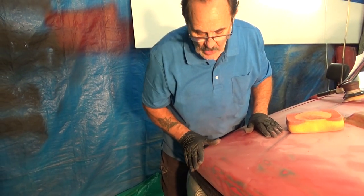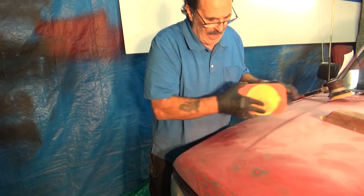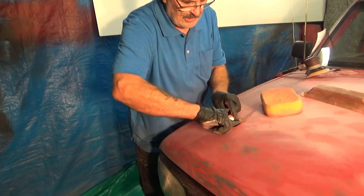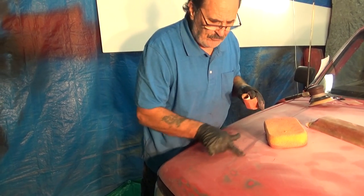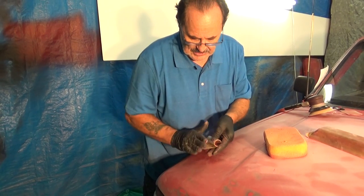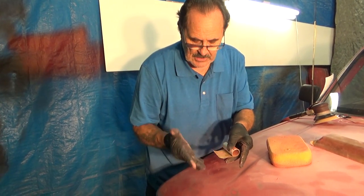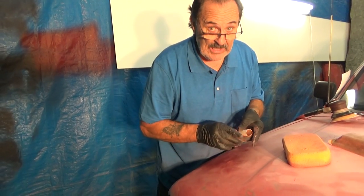When the paint goes on that, you'll not see one thing except glass right across there — and that's what you do to all surfaces like that. Now look at this — this sponge gives. I can push my finger in. If you use your bare finger on a piece of sandpaper, you're going to cause the curvature of your finger to leave a groove. If you have sandpaper across your fingers, every one of those high places in your fingers will leave a groove, and you'll end up seeing the wave in the paint final finish. This sponge gives to everything.